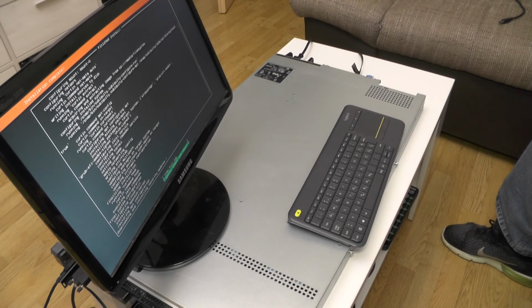For example, Windows had an update that screwed up. Windows had a lot of bad updates, but I can tell you two, and one I had a problem with, but thank God I have a test machine. The update had problems with antivirus, and Windows would get stuck at logon. Imagine if you have 50 machines and everybody gets stuck on logon. The other one was the last one with Intel ME, sorry. On a couple of machines the update crashed during the update of Intel ME, and if the Intel ME is corrupted, the computer will shut down within 30 minutes, and there is nothing you can do to fix that. Oh well, Windows.